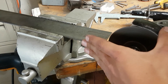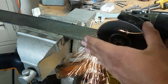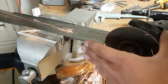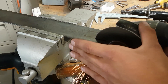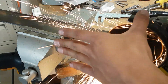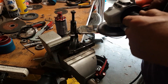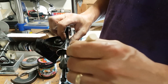I don't wish to talk too much about the motor mount because I would not recommend how I did it. I started with an earlier prototype which was a skateboard truck with the hole ground down to the aluminum, which allowed me to get to the solid steel axle underneath, upon which I welded a steel plate — so it's kind of a steel plate sticking out of the skateboard truck.